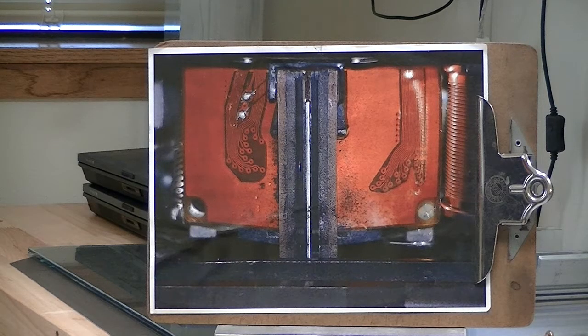When you think about airflow, how much air are you actually moving through that particular tape drive? If you look at a standalone tape drive in a desk environment — it's external, it's got a fan on the power supply, it sucks air through the back of the enclosure, and the drive has a little fan on it — it moves a minimum of 100 cubic feet per minute, or CFM. So you have 100 per minute; multiply by 60 for an hour, then by 24, then by 365. You will be amazed at the amount of cubic feet of air you're moving through a standalone tape drive. In a library environment with six drives, you're going to have six fans and additional power supplies, so you're moving a lot of air through there.